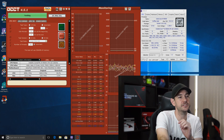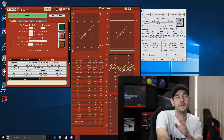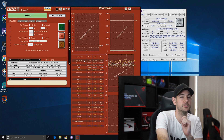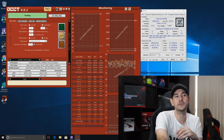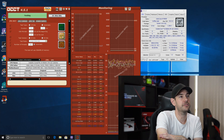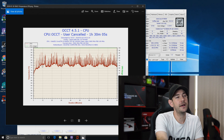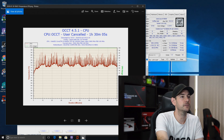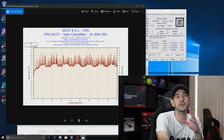We've been able to achieve this with a V-Core of around 1.3V with load-line calibration set to 7. One thing I want to quickly mention is you can see in OCCT our V-Core voltages are reading a little bit lower — I noticed that with the Z390A motherboard as well. Our temperatures are all well within tolerable limits and we were temperature limited with this overclock. The CPU would definitely go harder with a higher voltage, but once I started to push into higher voltages I was running into instability and thermal cutoff. Looking at the results in more detail, our CPU temperature took about 10 minutes to stabilize coming off idle, and then after that point it was just fluctuating in line with the load placed on the CPU. It doesn't rise any further for the duration of the test all the way up to 90 minutes — so we know we've got nice stable thermals for our CPU as well, which is very encouraging.